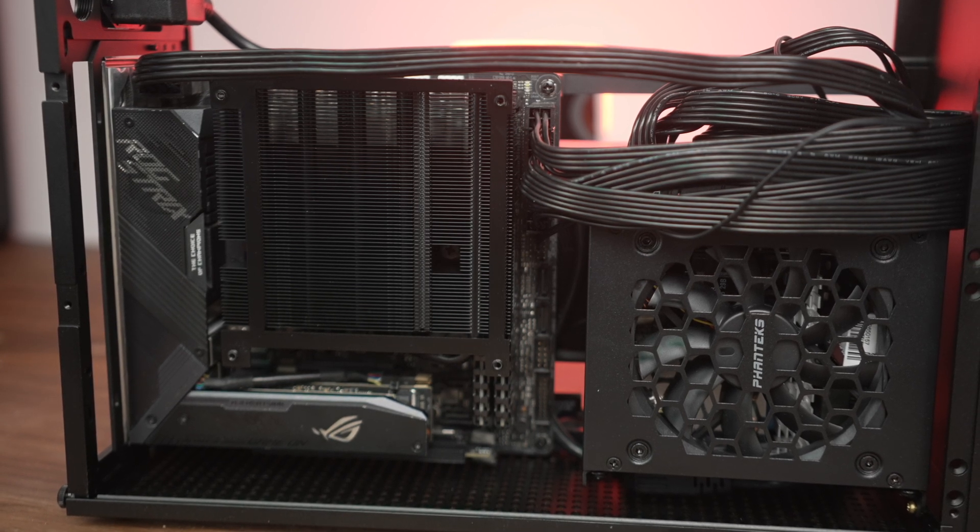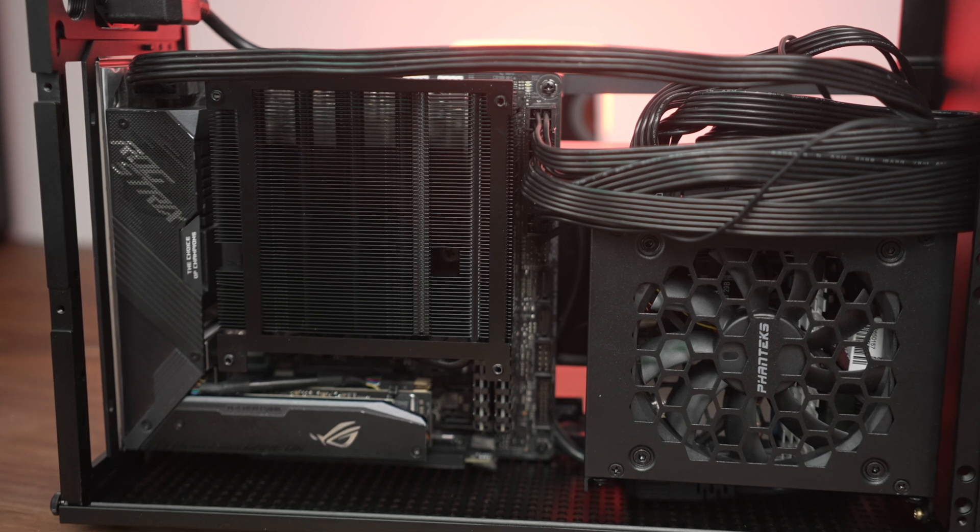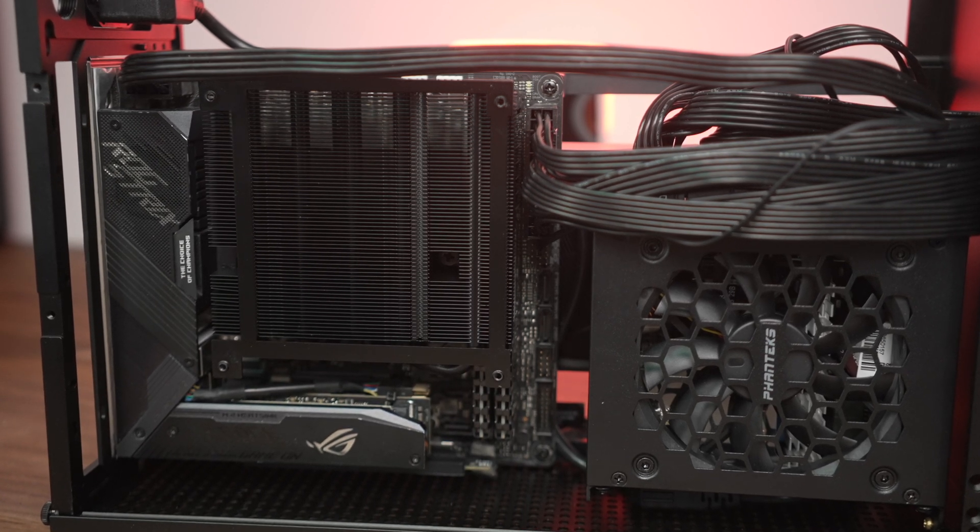Now, if you have a low rear IO assembly on your motherboard, you might just be able to get it to work that way, and you'd have a lot of clearance and be able to fit that 25 millimeter fan. But with the way many ITX boards are these days, I think that's gonna be a tough prospect. It's a pretty neat cooler otherwise though, and super height optimized.